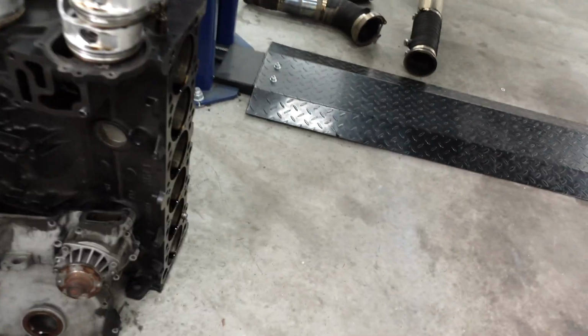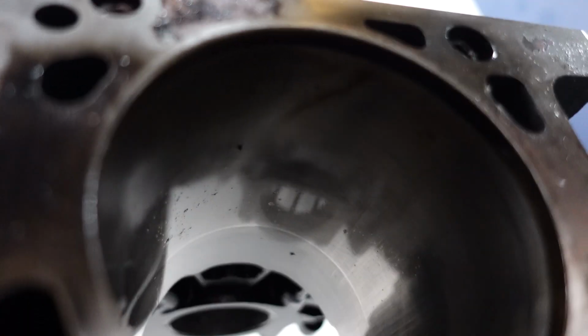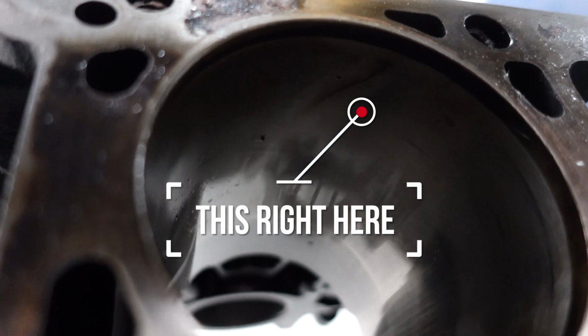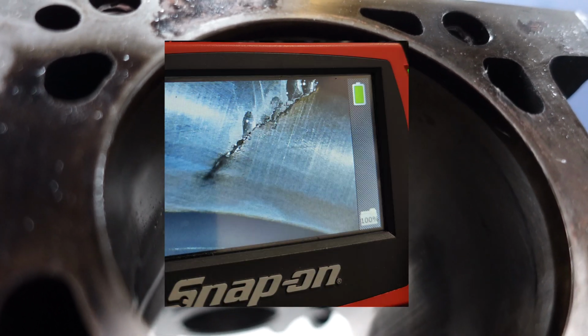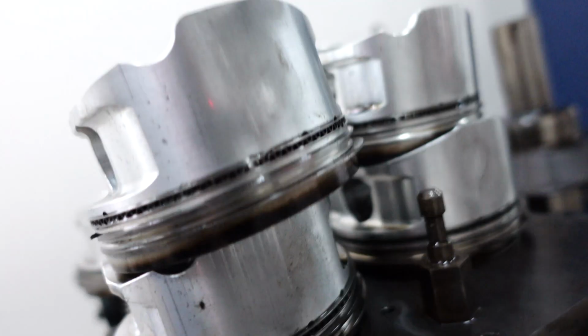We had a couple issues last time at the track, as you probably saw in our videos. We didn't have any of the faults in there, but we actually had an issue with the engine last time. I'll give you a quick shot of it right here. Started pressurizing the cooling system, due to that crack right there, if it'll focus. There it is. So after a lap, it was pressurizing the cooling system and blowing coolant out the reservoir. So time for a full rebuild.